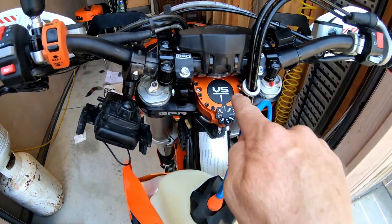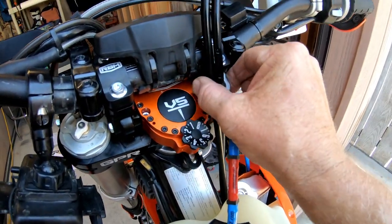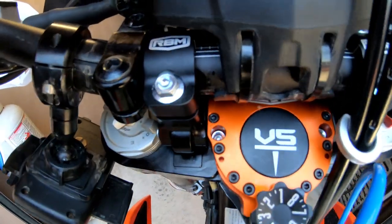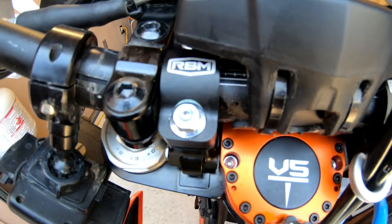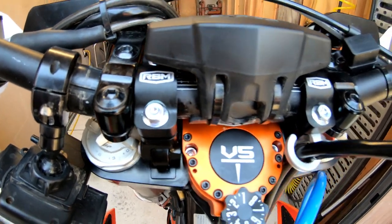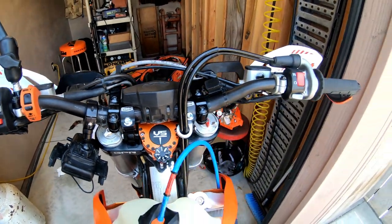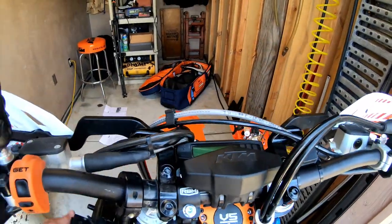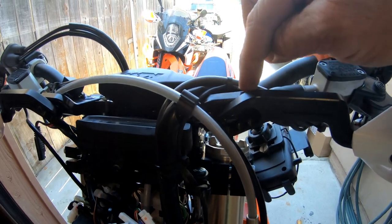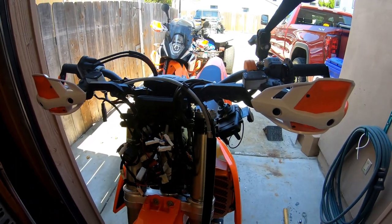The steering damper is on, both bolts tightened, and I double-checked the level of that pin — it's just perfect. The wire grabber is in place. Before torquing the handlebar bolts, I sat on the bike to find the correct position. Using the centering marks you make sure the handlebars are symmetrical on both sides and the forward and rearward roll is where you want it. I've got it about right, so I'll torque those bolts for the permanent bar mount. The handlebar guards needed alignment too so I left those loose, aligned them, and got everything ready. We're getting close to putting the front end back together.